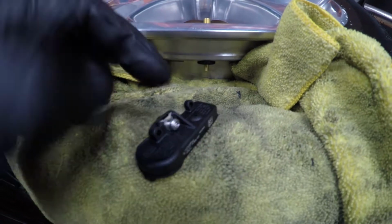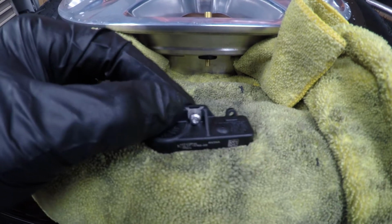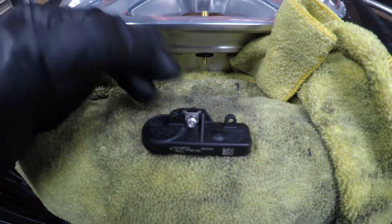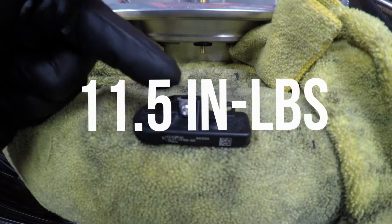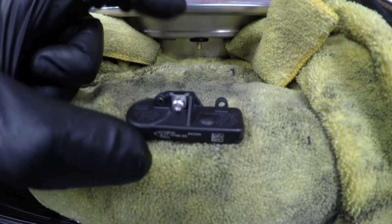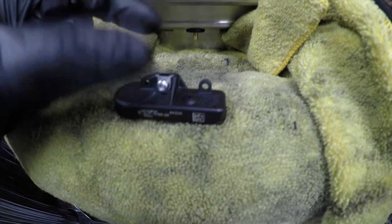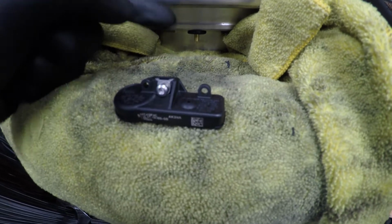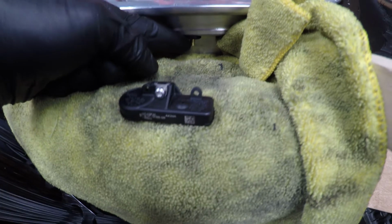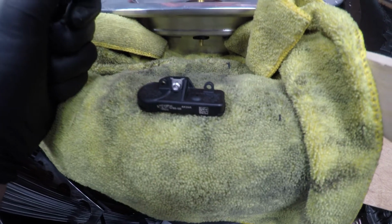You do want to torque this. There's a torque setting for this screw. For anybody that has some mechanical knowledge and works on some stuff and you get a feel for torque, 10 inch-pounds I think it is. So it's not very tight. A little 1/4 inch combination wrench that I was using, basically snug with that is about 10 inch-pounds. You know, it's not super science. This is brass. It's just gonna strip the brass out. So just snug it until you feel it stop, and that's good.